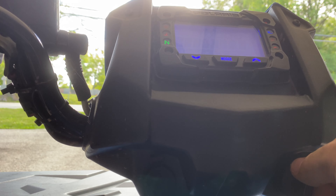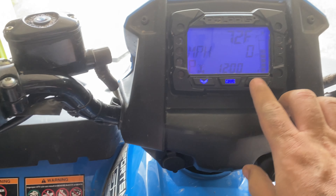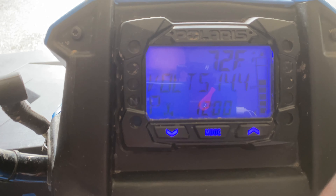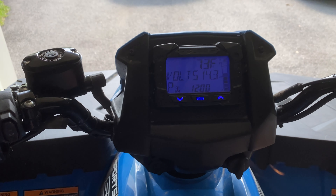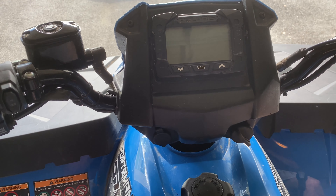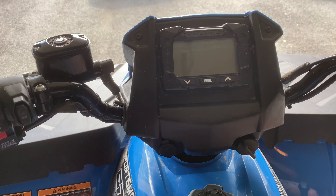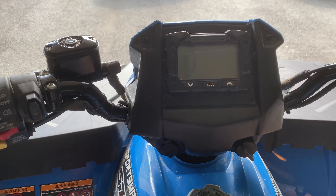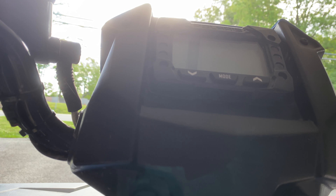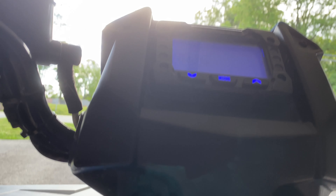Moment of truth — let's start it up. Oh yeah, that actually did sound a lot better as far as starting goes. Let's see what it says for voltage — 14.3, 14.4 volts. That looks good. I'm going to take it for a quick spin. Alright, quick spin done. The battery stayed constant; the startup definitely had more power versus the old battery — granted, the old battery was four years old and at its last leg. It fits perfectly and seems pretty good. I'll do one more startup and leave you with that. Sounds great!